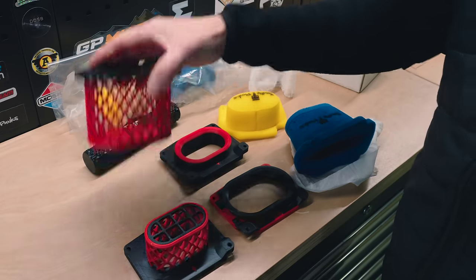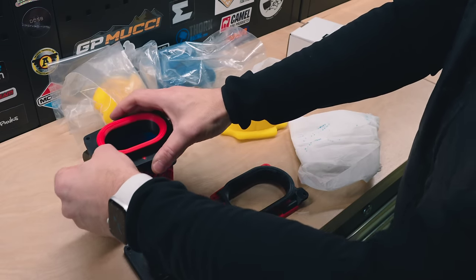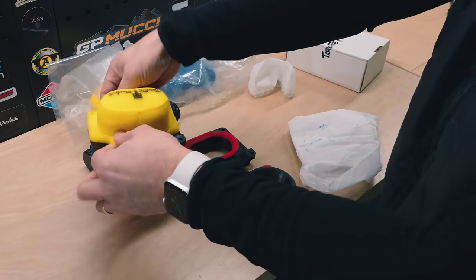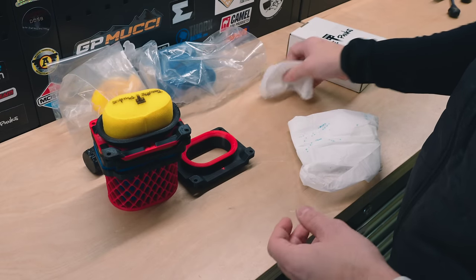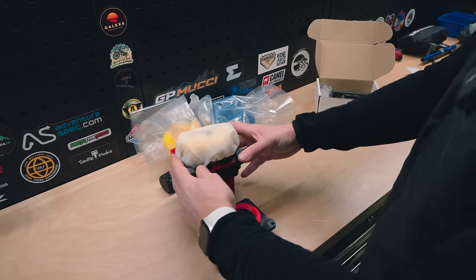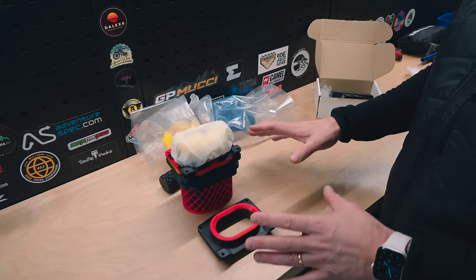You have the basket which takes the foam filter, and if you're going in less dusty conditions you can add the maximum airflow top on it. If you're going in dusty situations, you can instead add the pre-filter on top. You'll also have the option of an additional hat for extreme dust — like a Colombian cocaine lab. You'll probably never have to change the main filter. With the filter alone, they have measured it to give four more horsepower and four extra newton meters of torque, which is what we're after.